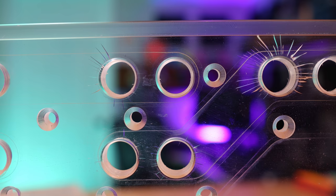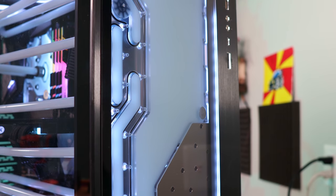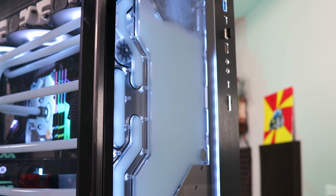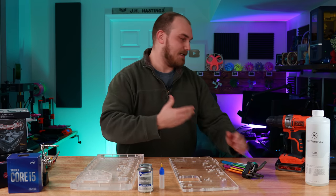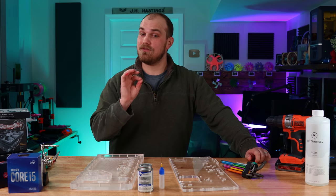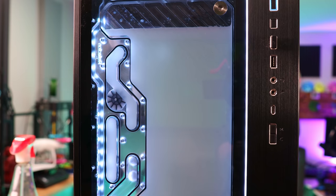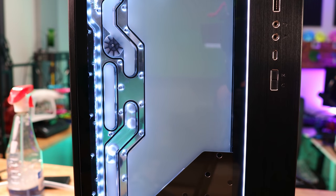Essentially, they just really didn't look that good in the long run, but I'm glad it's all fixed up. The hardest thing about the whole deal, to be honest, is the flow meter. The pin that holds it is a press fit or interference fit in the acrylic, so getting it out is tough. I recommend using some paper towels, grab it with a pair of pliers — you don't want to mar it up because you need it to be smooth so your flow meter can spin on it. Pull it out, and when you put it in, tap it down a little bit, not too tough because you might crack something, but you want to make sure it's seated. Other than that, it was a straightforward, simple process. Honestly, the hardest part was taking everything apart and putting it back together — this wasn't the hardest, it was the most annoying.